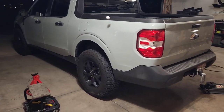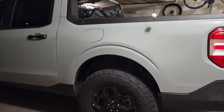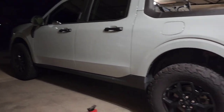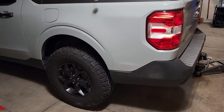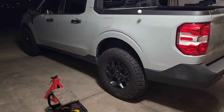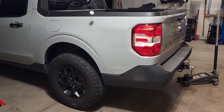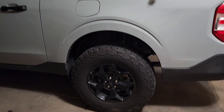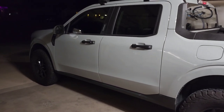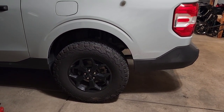It's on the ground, again about 15 pounds. It is a tiny bit higher than when I started with just 15 pounds. The bladders still aren't touching the complete inside of the coil, like it didn't balloon out, but it is holding it top to bottom. I was jumping in the bed a little bit to try to get it to settle. Might have to drive around and see what it looks like or feels like, but might just run the minimum of 5 pounds like it says, just for daily use and stuff. And then we'll try it out next time I have a load.